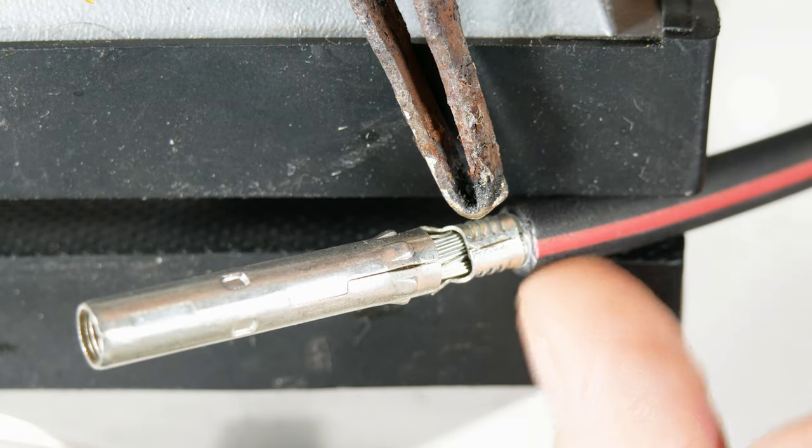We're ready to put the connector inside the plastic body. Be aware that with some brands, if you solder the connector on first you can't get the retainer nut in place and have to unsolder it — but this brand is okay. Make sure your seal is in place, the nut is in place, and snap it together. You heard that click — that's good. Tighten it down; usually finger tight is adequate. Check that the seal is good at the back, and now the positive side is good to go.